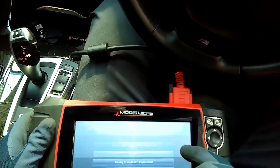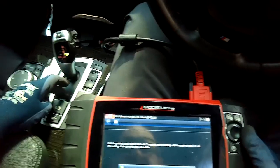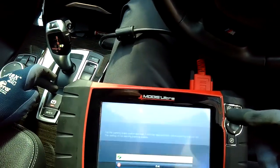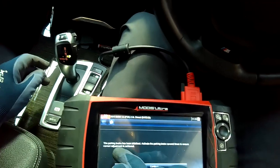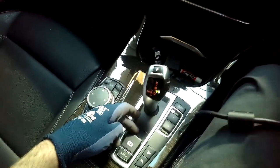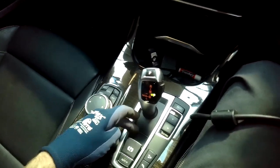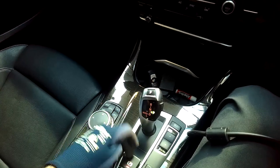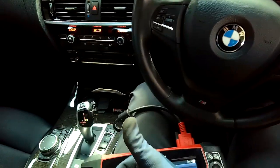The next part of the job is to go back into the vehicle with the scan tool and reactivate that motor. After I have activated the electric park brake in the outward position again, you cycle the park brake on and off a number of times — most good scan tools will have a step-by-step procedure. If you don't have a scan tool, a general rule is to flick it on and off about three to five times to recalibrate it back into position. I always recommend checking that everything spins freely when released and locks down tight when activated.